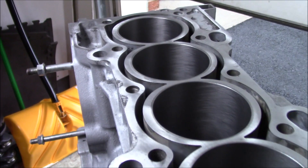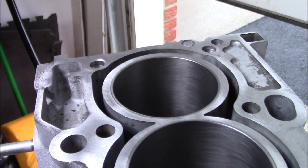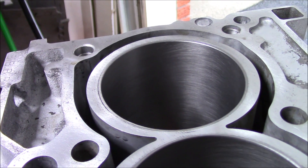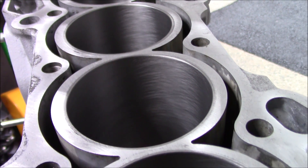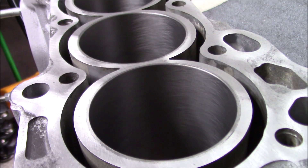This is exactly what we're doing — this is going to help just break these piston rings in. And if you refresh another motor that's not a high performance build and you put new rings on it, you want the same thing: you want those rings to seat properly. So this is exactly why I'm doing this. All the cylinder walls came out great — I'm so happy with the way they came out. They kept their cross hatches. All we did was freshen up each cylinder wall and they are ready for new rings.